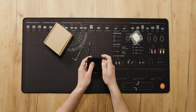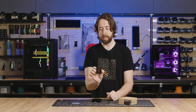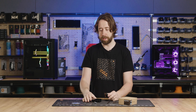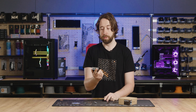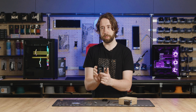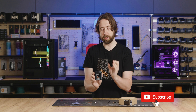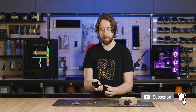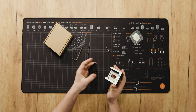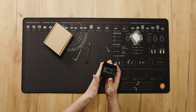The tool has a screw which pulls everything together, a slider which can be reversed and used in both directions, and the body itself. On the body you'll notice two triangles marked with number one and number two — the same on the slider — and these correspond with the position of the CPU. When the CPU is placed against triangle one, the triangle one side must also be facing up on the slider.